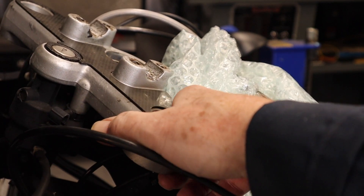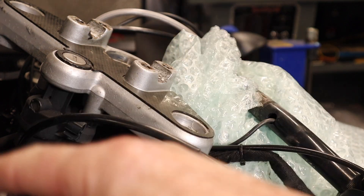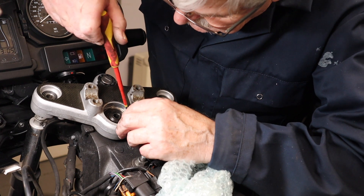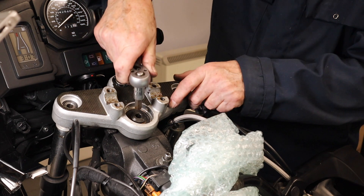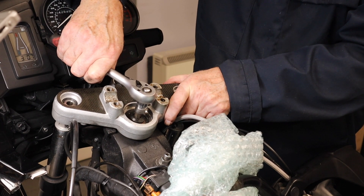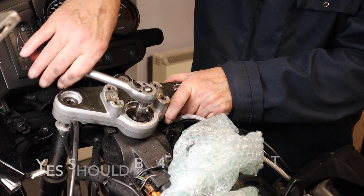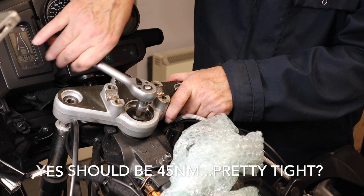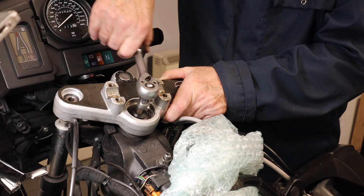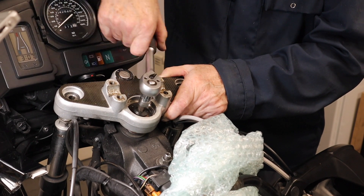This is what I've got to take off next with the removal of this bolt here, but first of all I've got to disconnect the cable to the ignition. There's a circlip in here to get out first. It's a big allen bolt - that wasn't very tight. I was expecting that to be really tight. That could be the problem. You don't normally just tighten these down because they're done to a torque and left forever, and then the circlip put on - so I'm going to change the theory now. Whatever happens, that was a strange thing.